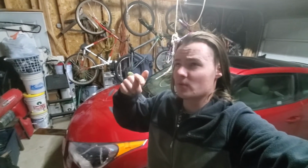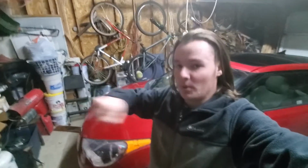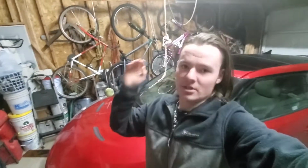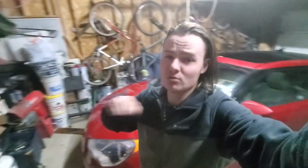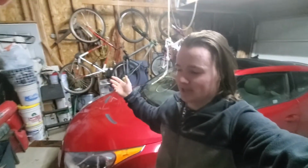I was on some forums, and they suggested go to a hill, pull the e-brake. So go up to a hill, put it in drive, pull the e-brake, and see if it'll still push you up the hill. Well, no, actually neutral, and see if it'll hold you from going back. So yeah, just pull that a bunch of times. It'll keep it adjusted, and you setting it all the time is going to keep it adjusted for when your brake pads in the back wear down from you just braking and using it.